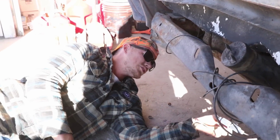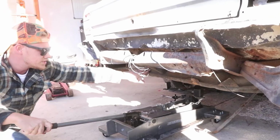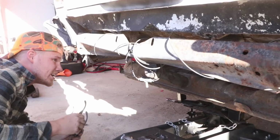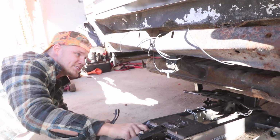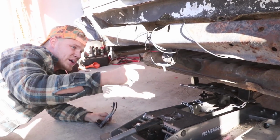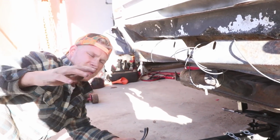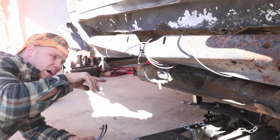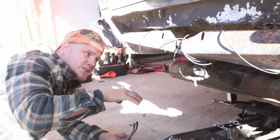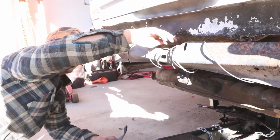Okay, we're unstrapped here. See what happens. You wanna watch your tube. There she blows. It's usually kind of funny to me because usually the sending unit's on top, but this one's on the back, so it makes it easier. Sometimes you gotta watch when you're dropping a gas tank. In later years, like the next 5-6 years, the sending units in the rear are on top. So when you're dropping it, you wanna make sure you stop halfway and disconnect so you don't pull that out.